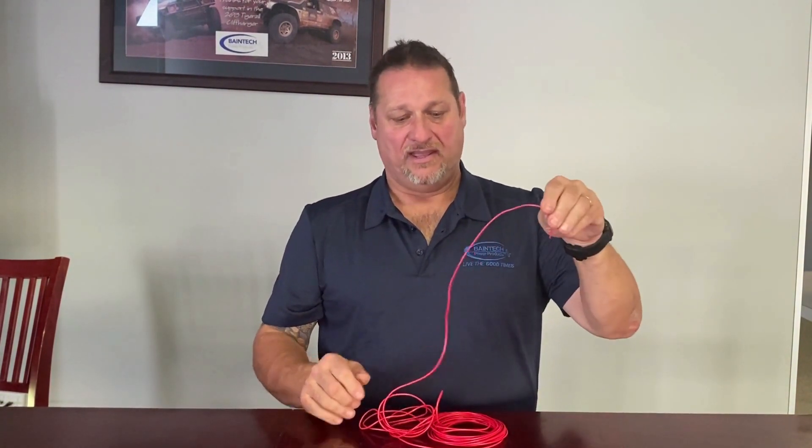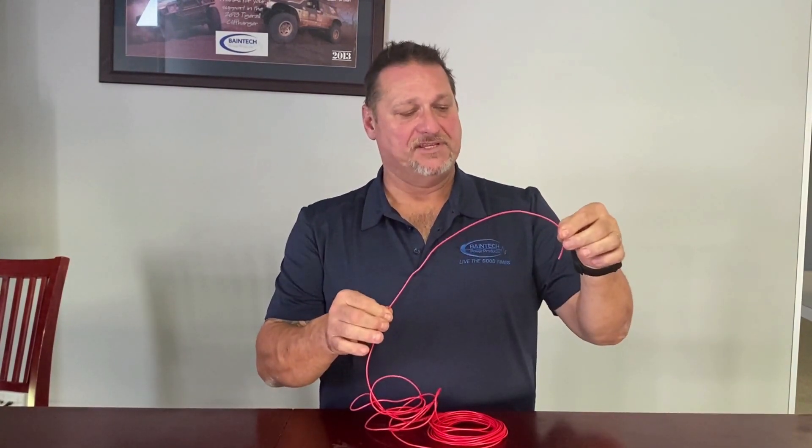The easiest method though is to install a safety or reset wire — if your installer hasn't already done it. When you flatten your lithium battery to the point where the BMS shuts it down, you start your car and get power from your starter battery into the DC-to-DC — up to 14 volts going in — but nothing coming out. What you do is run a cable from the 12-volt input side of the DC-to-DC and touch it on the 12-volt output side, which fools the charger into thinking it's connected to a battery and it can start charging.